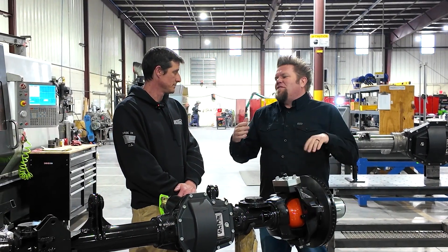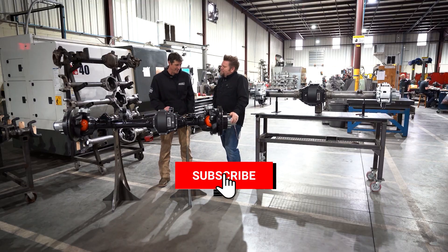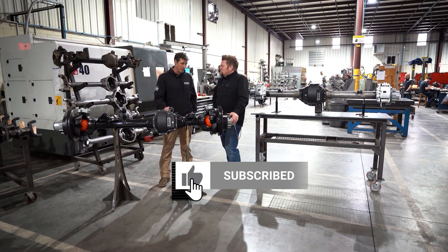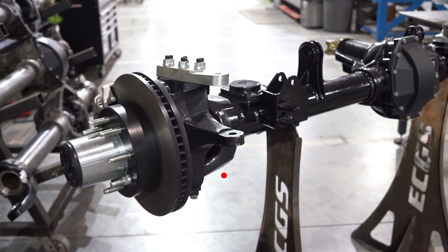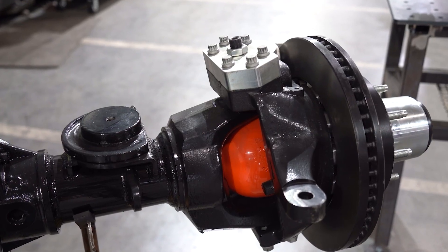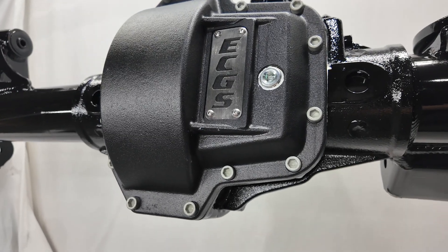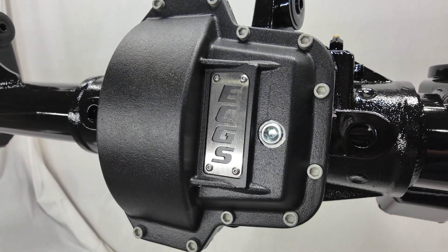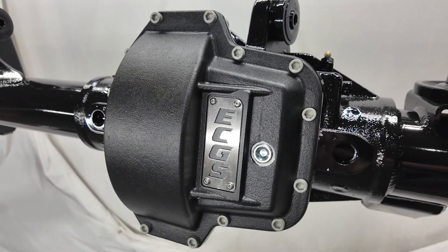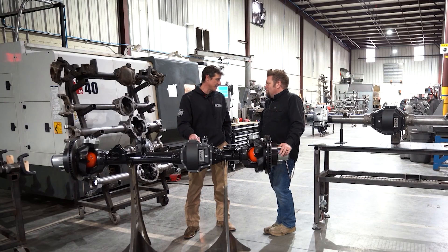What are you suggesting they put underneath their rig? So the wheel-end kit is the KP 540 for sure, because you can get 1550 40 spline or the Big Bell RCVs. And then you can do a 60 high pinion. We run the 10-inch ring gear in them, so run it on the strong side of the gear. It's going to be your best ground clearance with the high clearance casting that we have. So that's option one.